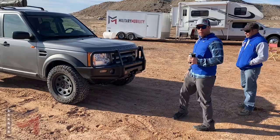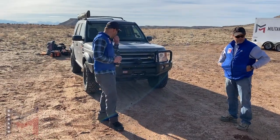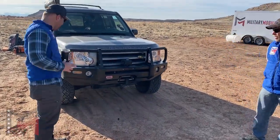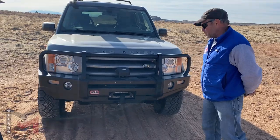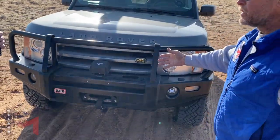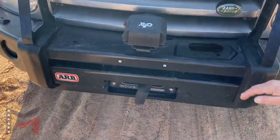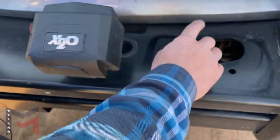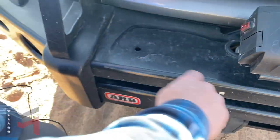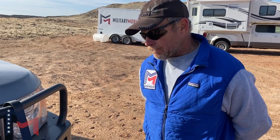We're talking about the front bumper. We've been holding off on what to get for our black LR3 — there are a couple of different options out there. What do you think about this ARB? It's beautiful, but it's not functioning. You can't see your rope, so you don't know if you're tearing it up or stacking it too much. To reach the release, my hand has been caught in there. Some friends cut out that portion to make it bigger, and we've actually cut the whole area out so you could reach the rope and make sure you're spooling it properly.